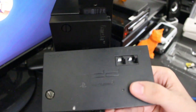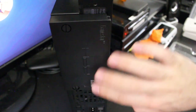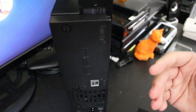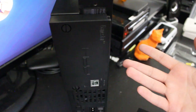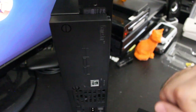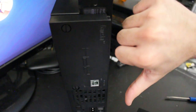So really this is up to you. If you ever want to use the network connectivity, you might want to stick to the official Sony one. However, if you're like me and don't really care for the network connectivity, this thing is great. With just a native SATA interface, you can use the full 3.5-inch hard drive, pop it in, and it's ready to go. The big benefits of SATA over IDE: better compatibility, my drive is much quieter, it doesn't generate nearly as much heat, and it's easier to use. Anyway, this is Mr. Mario signing off. Thank you all for watching — if you enjoyed this video, a like would be appreciated. And if you absolutely hated it and want to stick to IDE, a dislike is fine too.